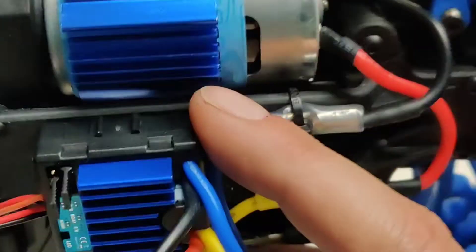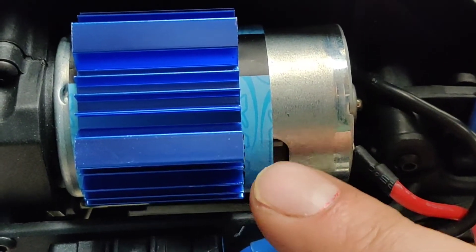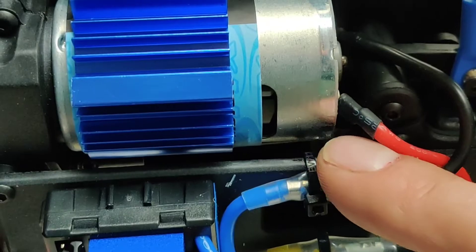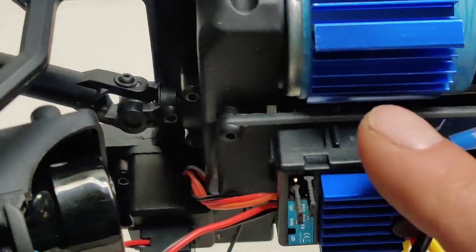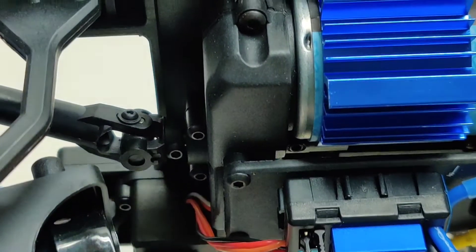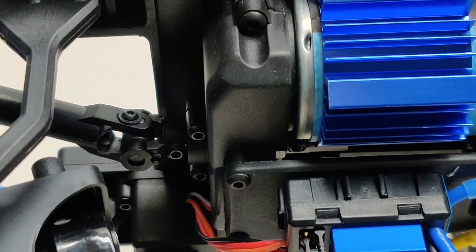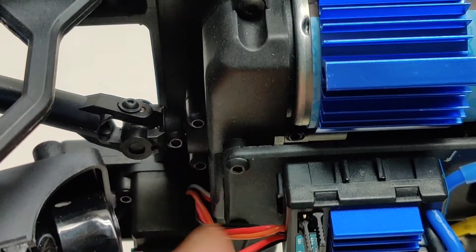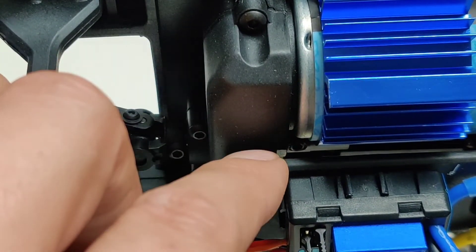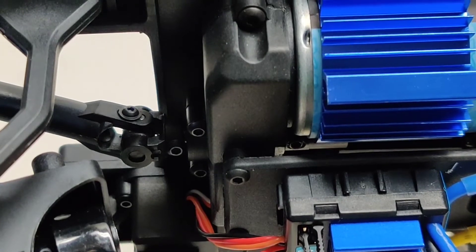The ESC looks like it's probably held down with just double-sided tape. The motor is a 550 brushed motor. They've popped a heatsink on, which is cool, and it looks like it should have holes drilled in it so you could attach a fan, but there aren't any holes so you'd drill your own. The gearbox has no gear reduction — just the pinion gear from the motor to a spur gear on the main driveshaft. Even though the main spur gear is plastic, you can run a ton of power through it with no issues. These are 32-pitch gears, and the coarser teeth don't seem to have the issues that 48-pitch or finer ones do.